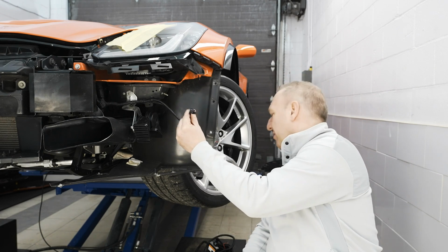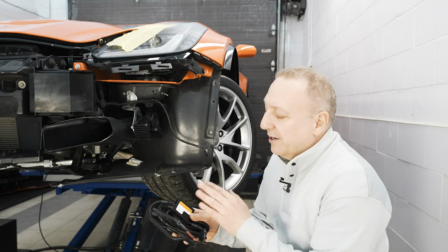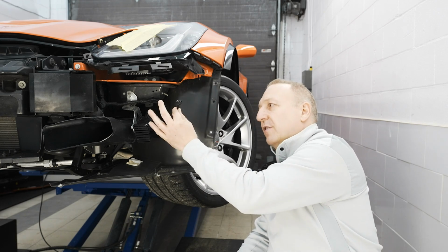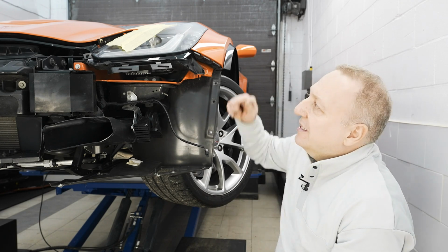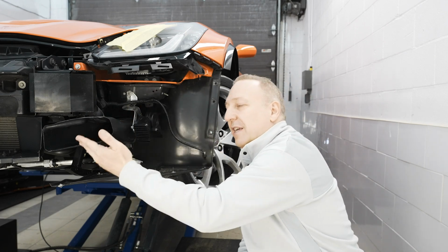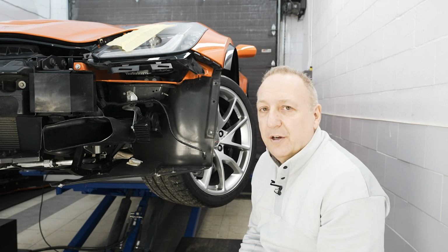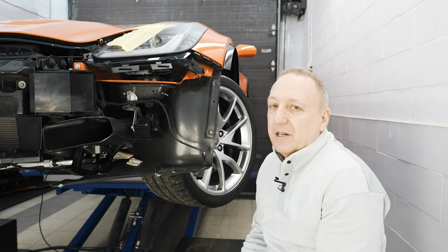I'm setting it up on this side. We supply you a harness with a controller. What this is doing is actually controlling the lights themselves through this circuit. And this circuit will automatically go on at night. The car is actually featured with a sensor located on the dash. When it gets dark, lights go on. Side markers always go on, and at the same time, the LED lights will always go on. So in reality, there's nothing for you to do but just drive the car, and these will always go on and they'll give you a really great look.